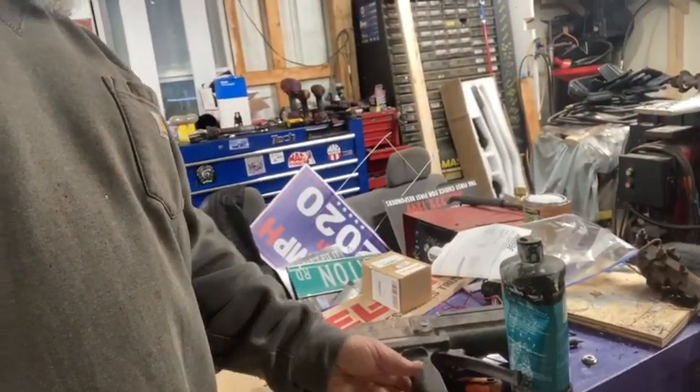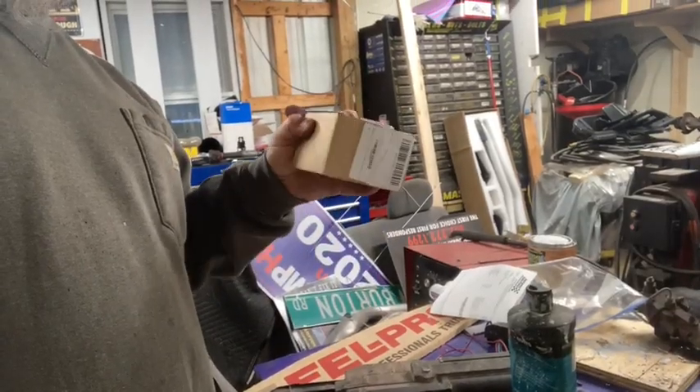That's all I've got for right now — I wanted to give you guys an update and let you know where we're at. As far as the Bronco we've been working on the channel — all the brakes are done and we just got our set of injectors in. We've got our upper intake gasket, and that's actually what I'm working on this evening. I'll pop the intake off and knock out these injectors, hopefully that'll get that thing running on all six cylinders again. I'll do a little filming on that — holler at you on the next one.